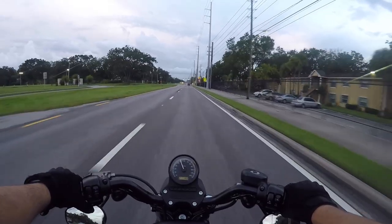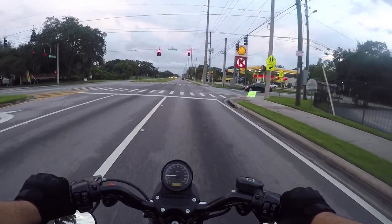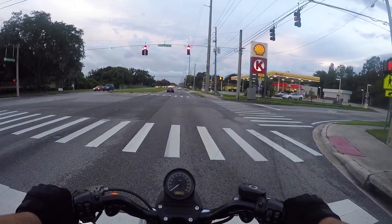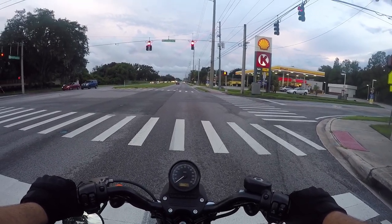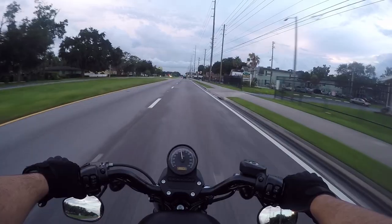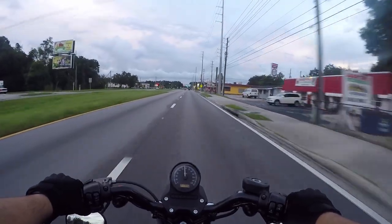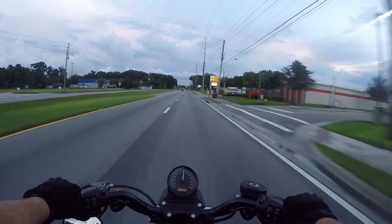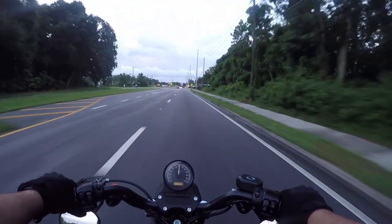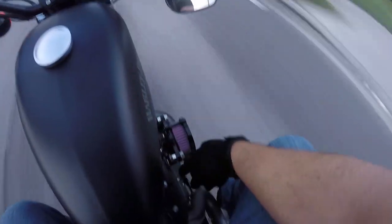Like I said earlier in that vid, I was actually coming up here to the garage to change out the air filter whenever it decided to just fall off on me. I'm being totally transparent with you guys, I'm not dogging any companies or anything like that. The experience I had with Figure Machine was a good experience. Their filter just happened to not fit my bike. So I had to return that one. The reason the Figure Machine didn't fit my bike was because it had a solid back mounting bracket which didn't have any wiggle room for the breather bolts. They were actually willing to work with me and create external breather bolts so that I wouldn't have to run it through their backing plate, which is super awesome of them. So it just didn't happen to fit my bike because the jugs are off on this one.